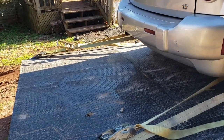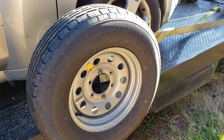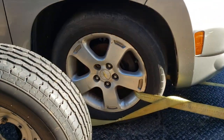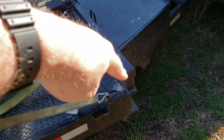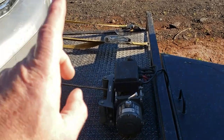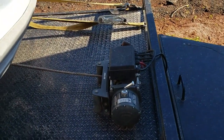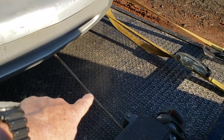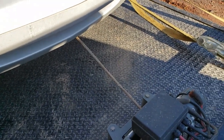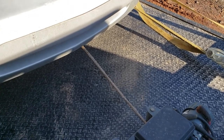There are some other companies I've found that make them that should be better. It does not have removable fenders, and that is and isn't a problem — the fender is in the world's worst location because we actually disassemble cars on the trailer, and you can't take a tire off with the fender in the way. I'd move that to the front somewhere. There was no provision to mount a winch on this trailer, so we drilled through the deck. There's a three-eighths piece of steel bolted to the bottom of the deck to keep the winch from pulling through. By the way, if you're going to haul cars, synthetic cable is the way to go — if you break a steel cable it will cut your head off, if you break a synthetic cable it just falls on the ground.